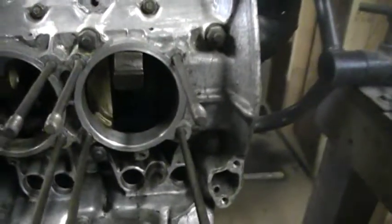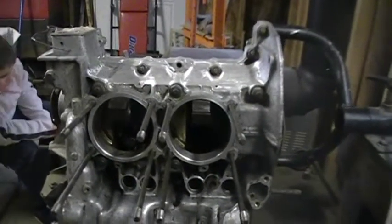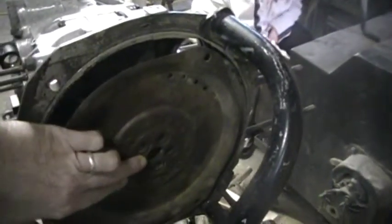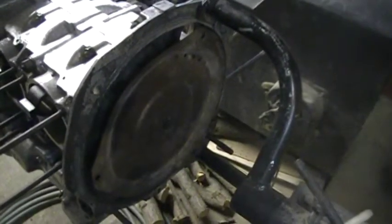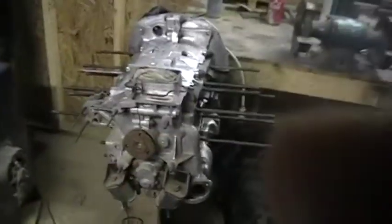The thing I like about them the best is it seems like everything they did with this was kind of evolved into what Volkswagen always wanted the Type 1 to be, in my opinion. For one example, on the old Type 1s you had just the big gland nut back here that could come loose if you didn't get it torqued enough. This has a 5-bolt design to hold the flywheel on — I like that a lot. This actually is what you'd call a flex plate for an automatic transmission.